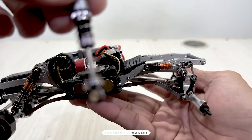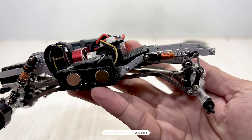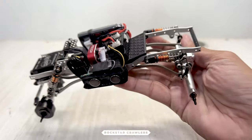Longer and bigger shocks won't work in this setup. Imagine putting these 39mm shocks — it's going to push back this lever and lift the height too much and also limit the travel. If you use big bore shocks, you won't get the correct angle to make the cantilever work smoothly.